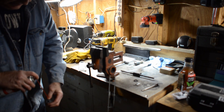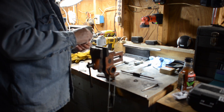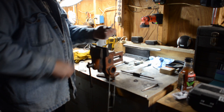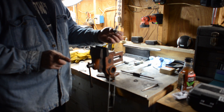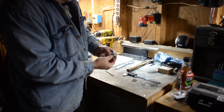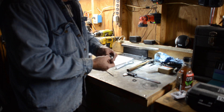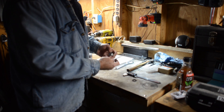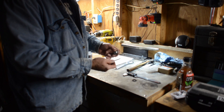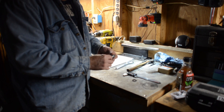Take a gun out and clean out the junk from the bottom. I want to go down a little bit more, so I'm going to go back to the drill press. I went ahead and re-drilled a little deeper, tapped a little deeper — you can see it's almost flush. That's fine; I just didn't want too much hanging out. I went ahead and drilled and tapped the bottom of this. I took my bolt for the dipstick, cut it off a little bit, and deburred the edges. If you don't have a welder, I suggest you leave it a little longer — you can put a nut under it as a jam nut to lock it in position.